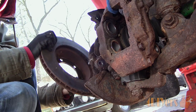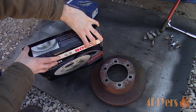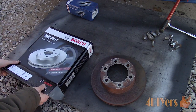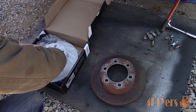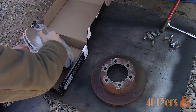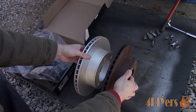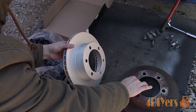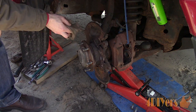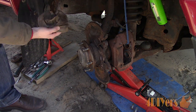Now remove the rotor, which simply sits into place. It's important to compare the old and new rotors to ensure they are the same. Bosch has provided me with their QuietCast premium brake rotors that are 100% balanced for smooth operation and have a bi-metal aluminum zinc coating to help prevent rusting. They give that clean rotor look, especially on vehicles with more open wheels, while providing a long life. Due to the new coating, there's no need for any cleaning during installation. Give the hub mating surface a clean with a rag to remove any dirt which may cause run-out on the rotor, as run-out will cause brake vibrations.